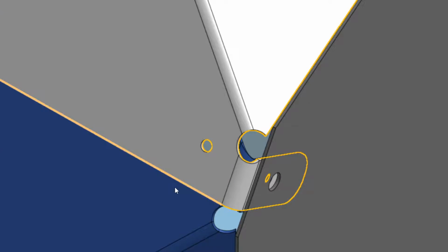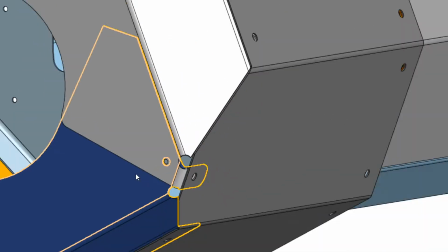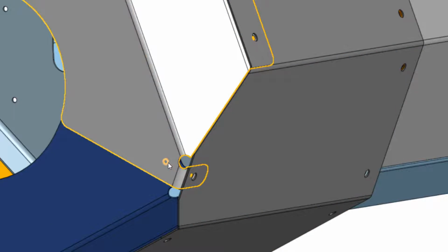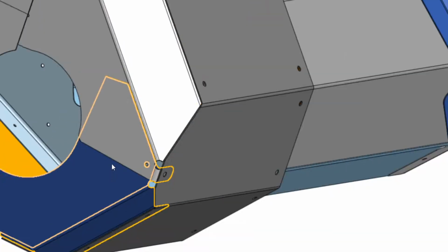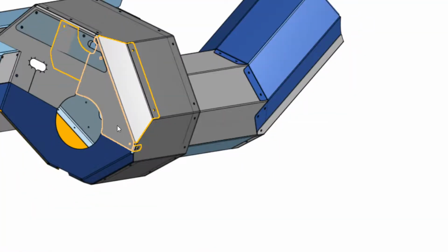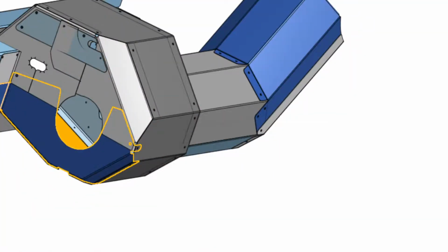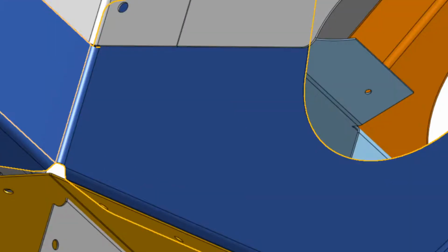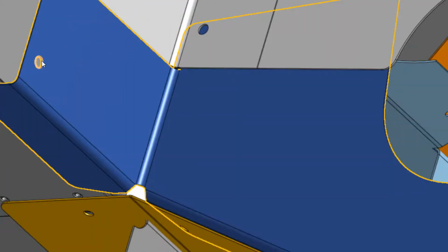That's the pilot hole, indicating this screw is going to come through from the right to the left in this case, and hopefully there's enough space behind it here so that we don't run into the compressor with that screw. But that screw would come from your right to the left and actually poke from the inside of the enclosure to the outside. Most of the other screws shoot from the outside to the inside of the enclosure. So if you get that screwed on, or the other screws that attach this blue piece to the manifold cover right here, that screw hole looks like it's the single one that will actually latch this one onto this left side manifold cover.